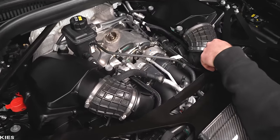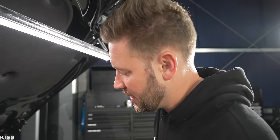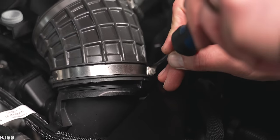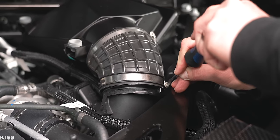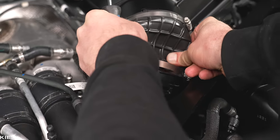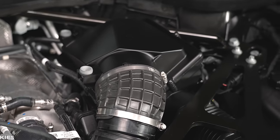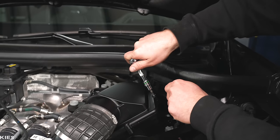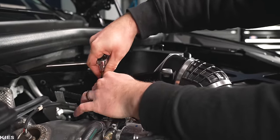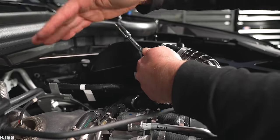Now what we're going to do is replace the top air boxes, doing it one at a time. First, I'm going to take my flat head and very carefully release the hose clamp here, and then I'll be able to pull that off. Then I need to release all of these little T20 screws that hold on the top cover of the air box. There's also this little line — you just need to unclip that. Make sure you're doing this when the car is completely cool because these guys get super hot.